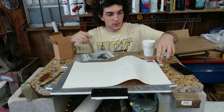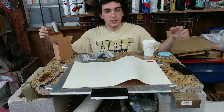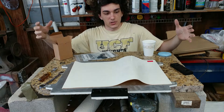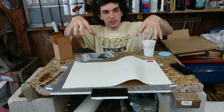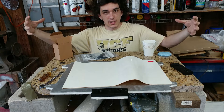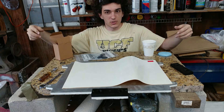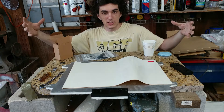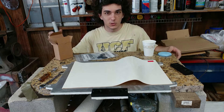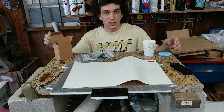I'm going to hold it together by running all-thread through the holes in the side of the plates. I've got four tabs on the side of the plates and I'll use those at first. I'm planning on making some reinforcing plates for the ends that have additional tabs for more clamping force — probably thicker steel plates — which should distribute the force more evenly among the stack. I'm also going to do a little prototyping to see whether those plates can have features that will help hold the battery into the car.